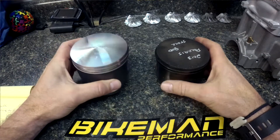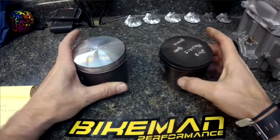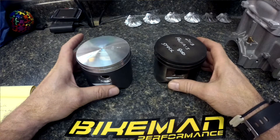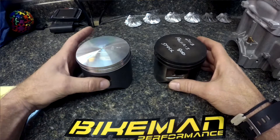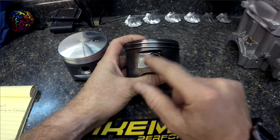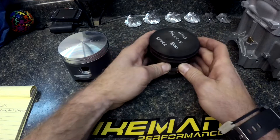The Bike Man durability piston is also a lighter piston, so you're going to have less harmonic vibrations. One of the other things not incorporated in the first 800 CFI Polaris pistons — but that Polaris has incorporated in most later models — is the wrist pin is offset 20 thousandths towards the exhaust side. That straightens out the skirt load a little bit and makes a longer-life piston.